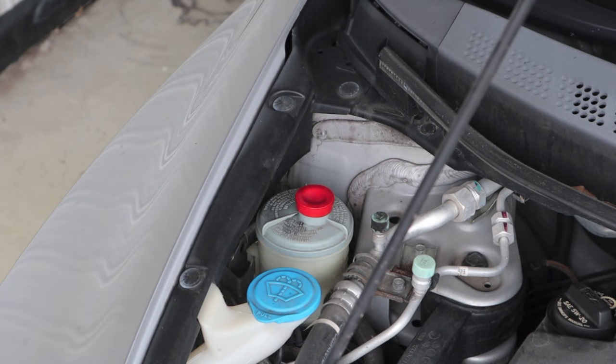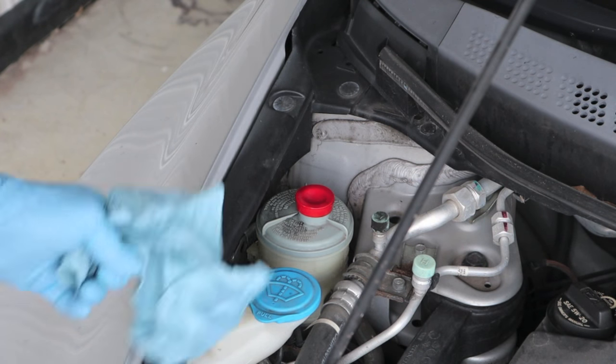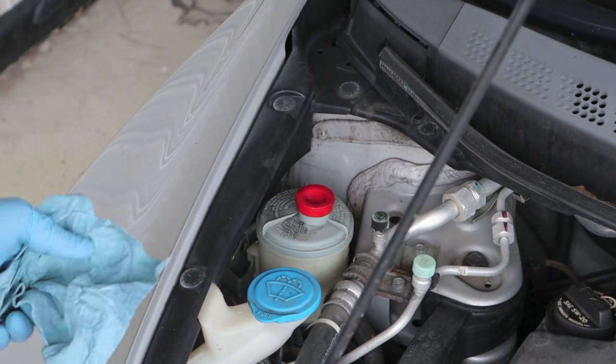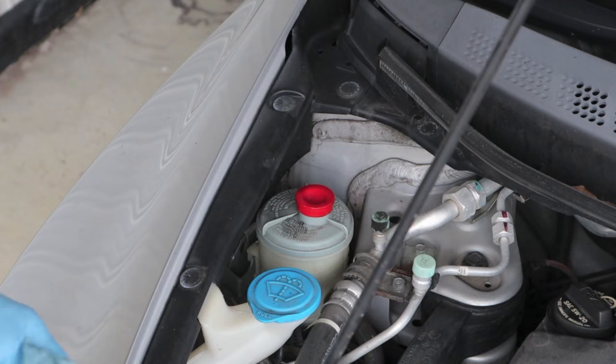I've seen some power steering fluids get in some pretty rough shape to the point where it destroys the power steering pumps. A lot of that could come from a rack and pinion failure. When a rack and pinion fails internally, that debris has nowhere to go but to the power steering pump and the reservoir. Some of the Hyundais have an inline filter in their power steering systems to save the pump in case there is a failure in the rack and pinion or the pump, to not contaminate the rest of the system. Cheap and easy.